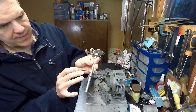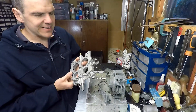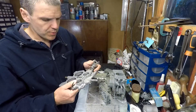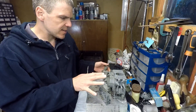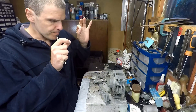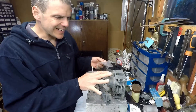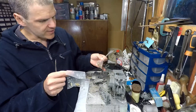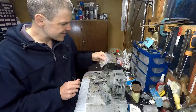The other issue is there was some pitting on the primary shaft and some corrosion on the throttle plate, so if I'd left this for a long period of time it could have seized and become much more complicated to fix. That's why whenever you're putting a carburetor away in storage while getting parts, it's quite important to make sure you clean it well enough — not necessarily the final clean, but good enough to diagnose that the unit is okay.